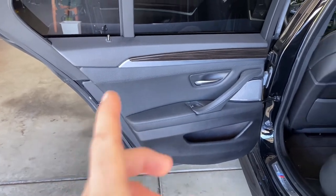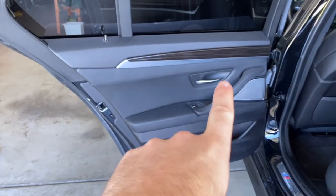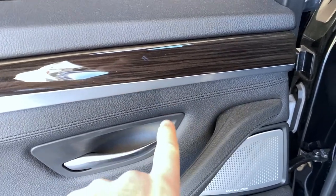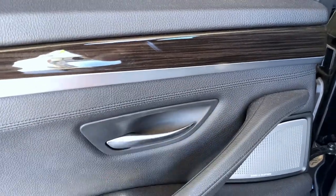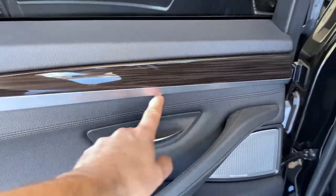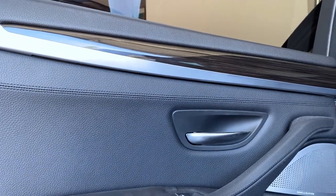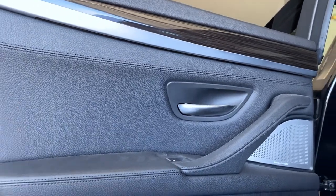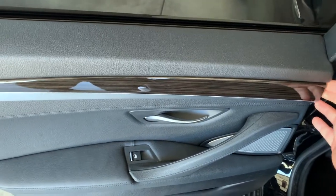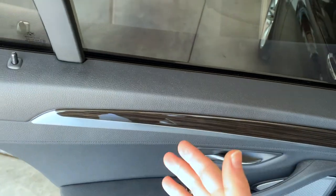First let's go into the rear door panel - this door is pretty much the same as the other two side doors. For the rear doors you only have one screw that holds the door panel, behind the little release. You push up, push inside and up - wedge it up and push down - then clip it out. There's one T30 behind there and that's it, the rest is all clips. Since I want to replace the broken bar, I'll take that out while the door panel is still attached - it makes things easier.